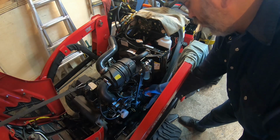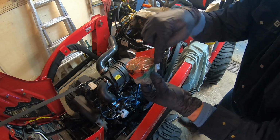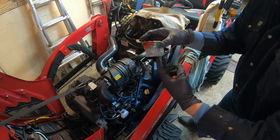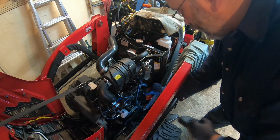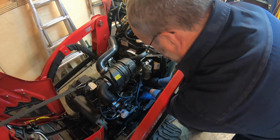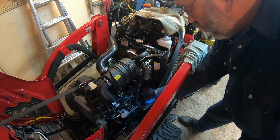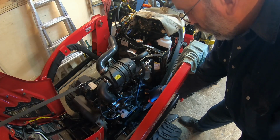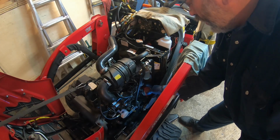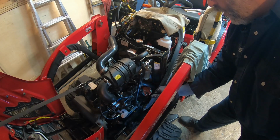I'm just going to put it right over. I made a lip here, so when the fuel drops in there, it falls down and does not go directly on the oil filling cap. I'm just going to put it right above and put the hoses like this, and there we go. When the fuel goes down, it will never go on the edge here. It will fall all around, and no diesel will contaminate the oil. So that's the first tip you need to think about.